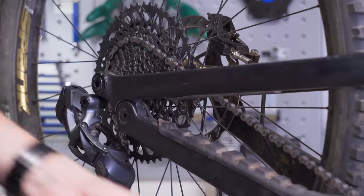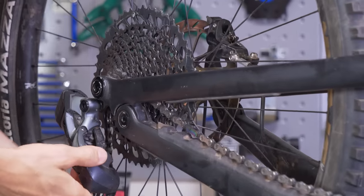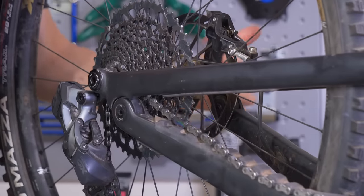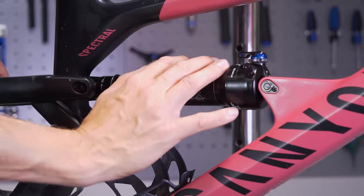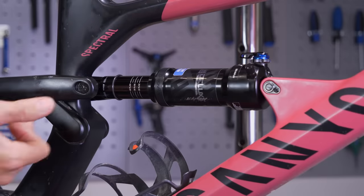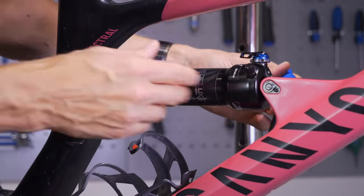Let's get the old shock off first. Rear wheel off first — you don't want any additional weight on the rear end straining the shock mounts when you remove the shock. This one has a cage lock; if yours is a Shimano, turn the clutch off to make it easier to get the rear wheel out. When removing your shock, on some frame designs this part of the frame can foul on your main frame — the rear end may drop down and contact the linkage, taking off some paint. If that's the case, stuff a rag in there to prevent damage.